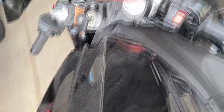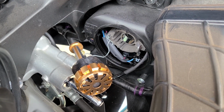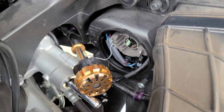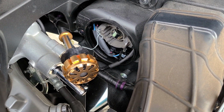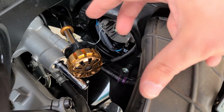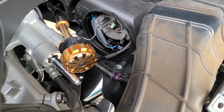All right, let's pause. Kind of see here, you want to get all the wiring stuffed in there as much as possible, because that's what stops you, as I found on the other side, the wiring stops you from screwing the cap back on. You would think this would stop it because it sticks up so much further, but actually it's just perfect that it fits in there. So the wiring is what stops you. So I'm going to continue doing that. I need both hands.